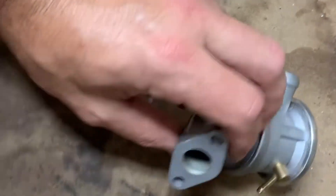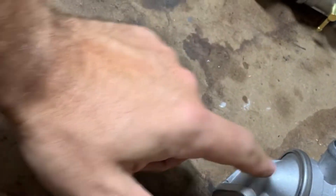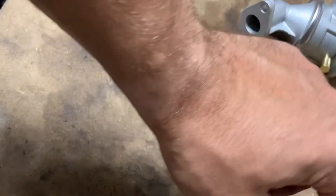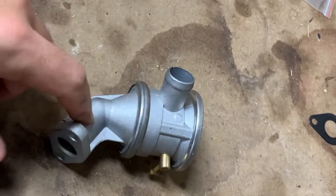Let's try the same test — blow into here. You can hear air coming out of this one, so the check valve is actually not working on this one either. If I was to install this on the car, the exhaust gases coming through here would just blow right back into the secondary air pump. Similarly, if I blow through here it does what it should, but I don't even feel it really open up.